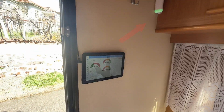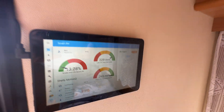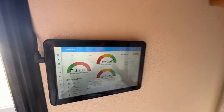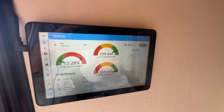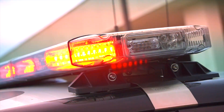The end goal is the following: when I enter my camper, a smart motion sensor or a door/window contact sensor will detect this action and the Home Assistant alarm will go into a pending state, in which I have to enter a secret predefined code within several seconds. If the code is correct the alarm will be disarmed. Otherwise, if the code is not correct or the pending time passes without any code entered, the alarm will be triggered.